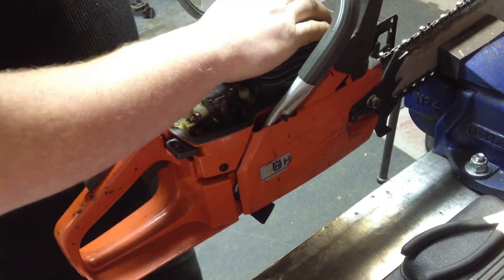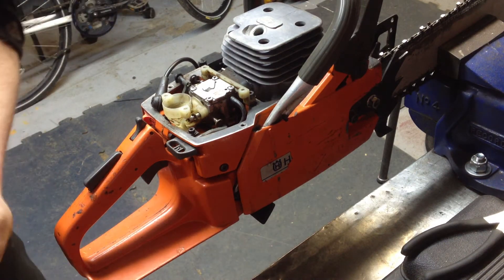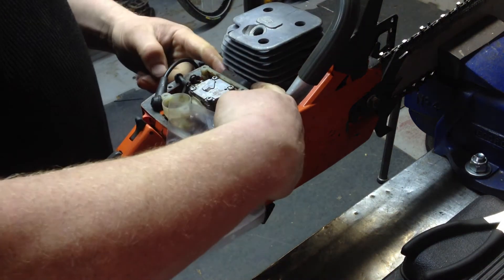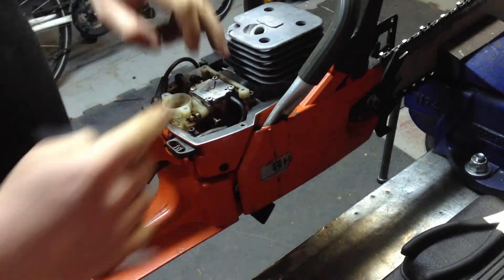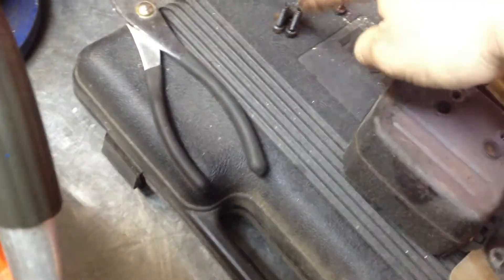And there you go — looks like she's on there. There's a new gasket for the intake right there, which sits down in between the carburetor boot and the cylinder. Then you've got your four bolts — one, two, three, four — which are the four that you took apart before. Your muffler, your shield, your shield, your muffler, spark plug, your covers, etc. We'll bolt the sucker all together, torque it, and I'll take it outside and we'll try and fire it up.